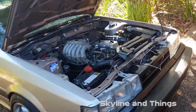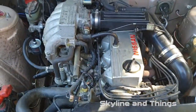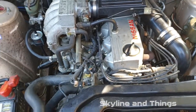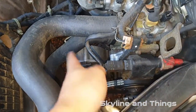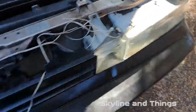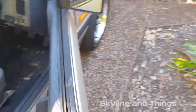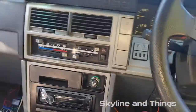The Liberty is auto and the Skyline's manual. ChrisFix said to wire it to your fuel pump relay, but Nissan Australia geniuses don't have one. So the way we're going to do it is wire it up to the ignition coil — just tested it and it works. There's a toggle switch and we'll have to hide that somewhere, which is a secret. Pretty much what it does for my car is cut spark — no spark, car don't go.